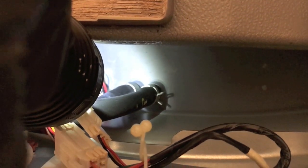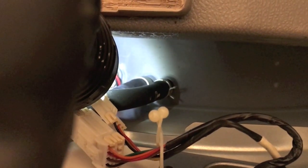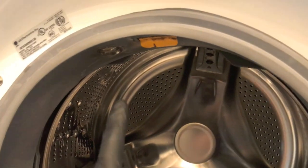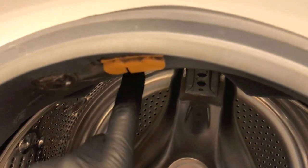Up to the top portion of the washing machine on the back side, I want to point out those 2 rubber hoses that go into the actual rubber seal. Go ahead and pinch those clamps, and as you pinch them, shift them upward to alleviate the tension on the hose, and go ahead and remove both those hoses as well as the electrical connection point on the far left. And in reference of the actual seal, this is the light that turns on and off, and this is the portion where those 2 rubber hoses go in and clamp into place.